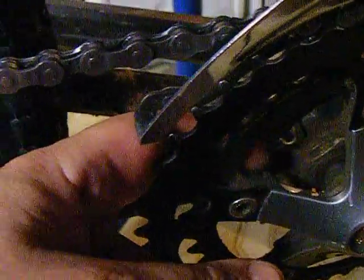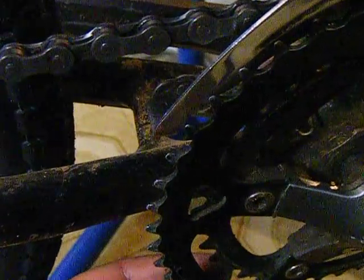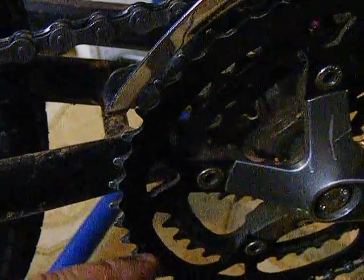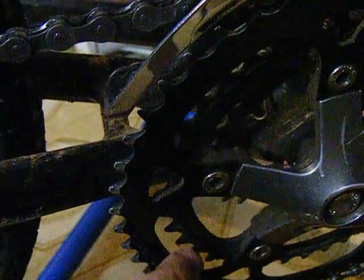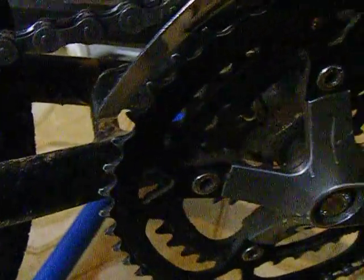The gears: the top ring here is original. The smallest one is original; it's just not connected right now. The middle ring was replaced — the original one was just way too worn out, it only lasted a couple of seasons for me. The original one was egg-shaped; I had to replace it with a round one, so I found a 38-tooth round sprocket for a Suntour bike.